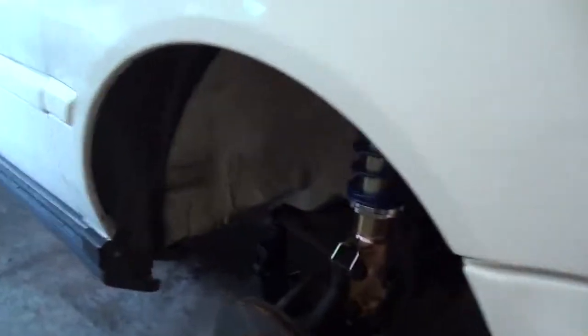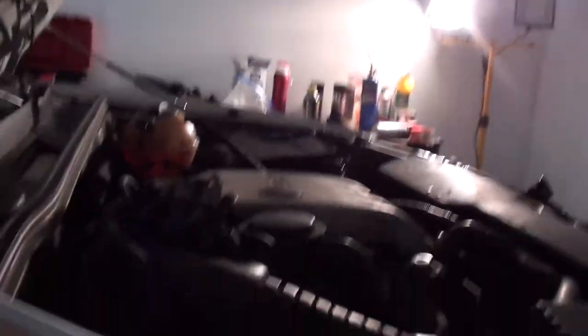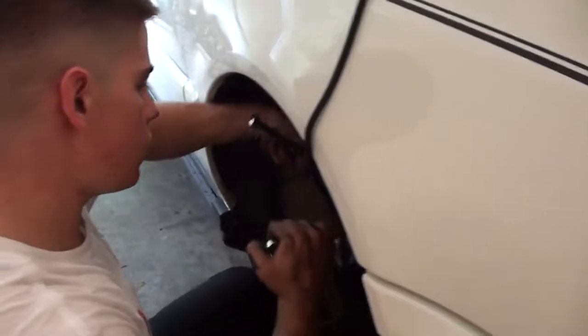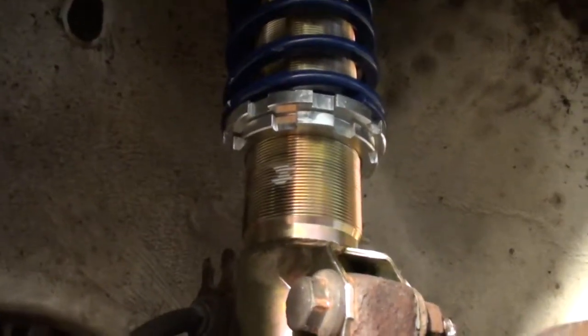It's up to you how much camber you want to run. We got this tightened — just used one of the new nuts without Loctite and hit it with the impact, and kind of lower and raise the steering knuckle. You got to set your own camber here. We're just kind of eyeballing it because $200, I guess. I'm going to run blue zip ties to match the springs here and hold the brake cable on. Almost wheel time — just measuring and counting threads to get the sides equal.